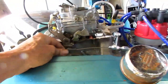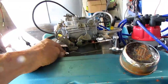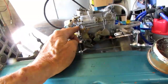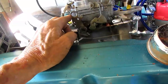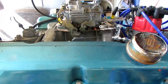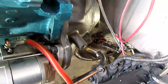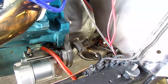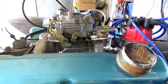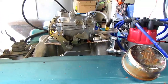Just get this little cable kit — it's not very expensive, about 30 to 40 bucks — and you can put it all together. I've got it set where I think it'll work well. At half throttle it's starting to move the kickdown, so you're accelerating pretty good. You want it to shift a little higher, and if you stomp it into those back two barrels it's going to downshift. If it shifts a little high or low, you can adjust this to suit your needs.